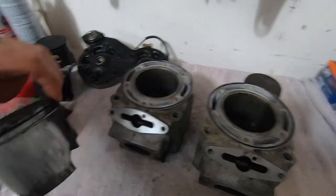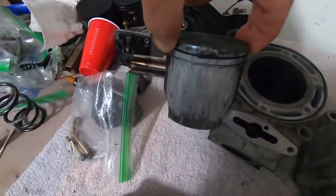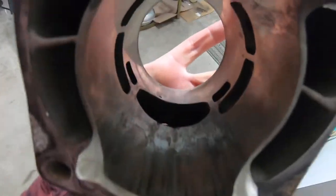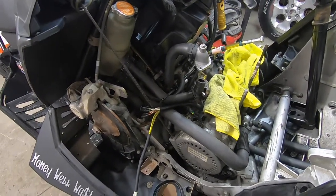We actually had a busted ring, and then the piston ring land opened up and actually broke near the top. So I'm gonna send this jug out because there's too many scratches in there. I mean, the aluminum you might be able to get off, but the scratches are deeper than I care to see, so I'll probably get that replated and clean and test my injectors, put it back together and hope for the best.